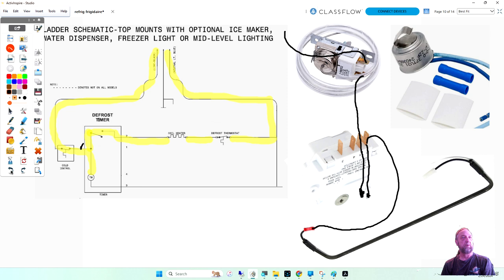Shouldn't matter, right? It shouldn't matter, but if we're going to follow the wiring diagram, it does matter. It's like a bulb. I mean, what's the point? Yeah, it doesn't matter in its physical operation, but we try to keep things organized, because when you start moving wires around, then you get confused and lost. Well, what is neutral right here? Light blue. So the heater is going to go to the dark blue one, and the light blue one I'm not going to use down here. This light blue one's just going to come out and go back to the plug, which would be this wire.